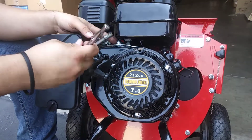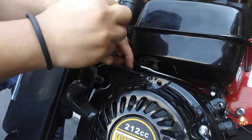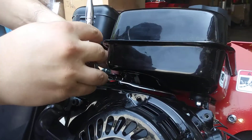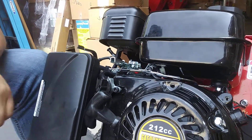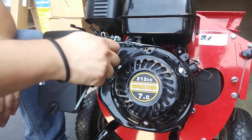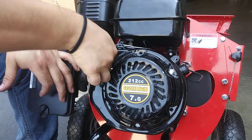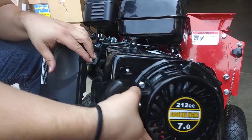Up here, this one — you're going to want to keep your finger close to it as you take it out because you can lose it into the machine. Once you have the shroud done, this is already loosened. It's best to do this first with the 5mm. You're going to remove the shroud to the side.